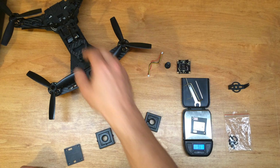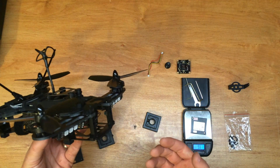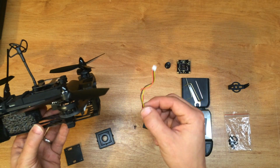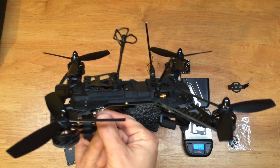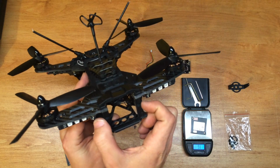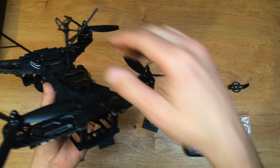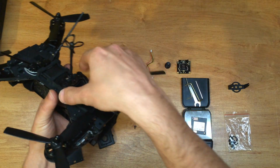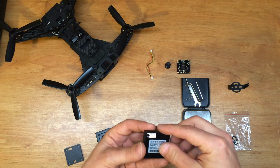There's a few screws. First, you're going to want to take the factory camera loose from the runner. To do that, first unplug your camera cord, which for me was just easier to unplug from here. You've got two screws, one on each side of the camera, and that's what holds it in place, keeps it from tipping, and allows it to pivot. So you take those two out, unplug your cord. Once you get that cord off, you'll be left with this.